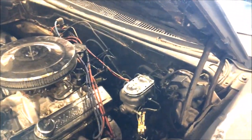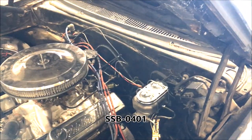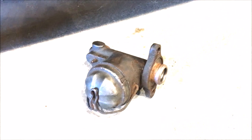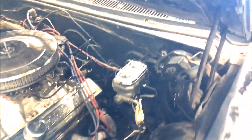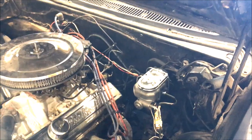I got into a bit of a panic and rushed to finish — forgot to take video of it. The master cylinder is from Summit Racing, part number SSB-0401. It bolted directly into the 66 Impala — the push rod was the exact same length and the bolt pattern was the same as the original single-chamber design. I never even changed the push rod. This is the non-power-brakes version, which may account for the price difference since I don't have power brakes.